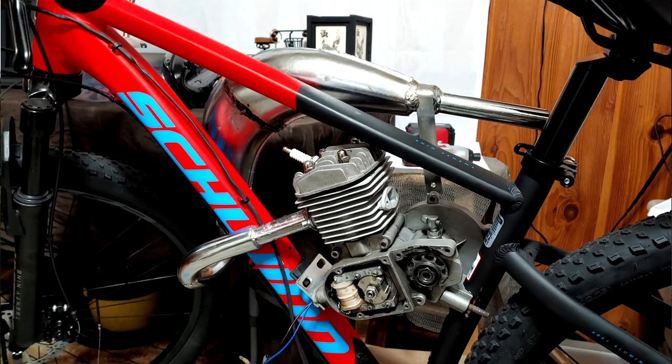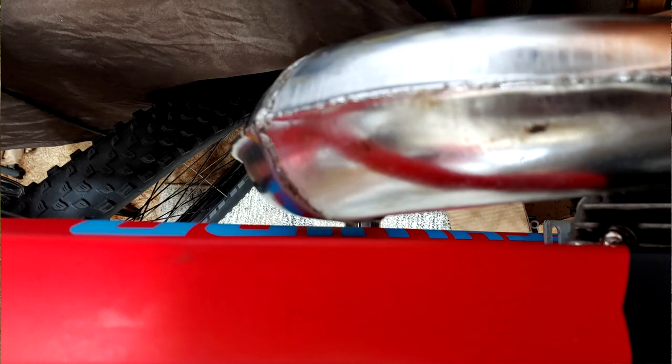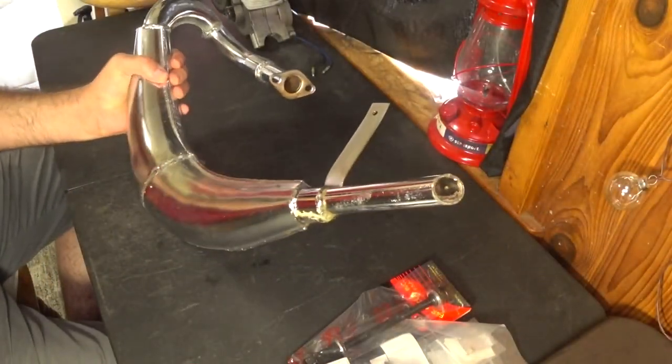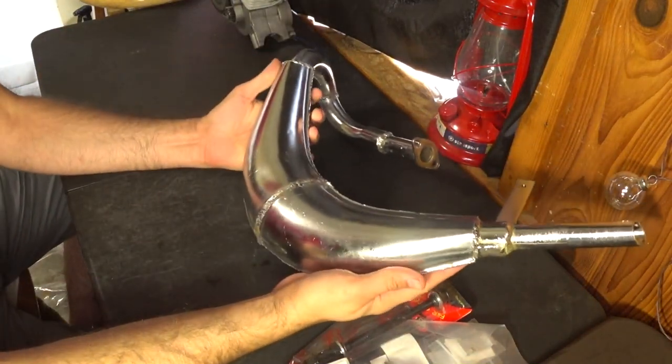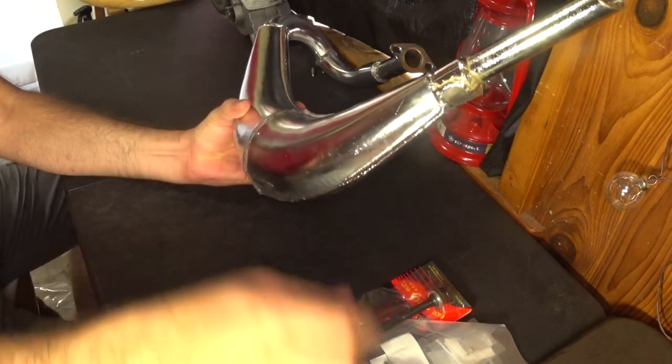The WC80 pipe — I think they do some kind of drop shipping with it, because it showed up a couple of days after I ordered it. From the pictures, it looks identical to the BikeBerry Deluxe expansion chamber. Both of them show absolutely terrible welding, and mine's no better. The welding on this thing looks like garbage, but there's no pinholes. I did a pressure test — it holds pressure, so we have a sealed pipe.